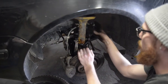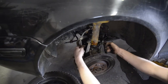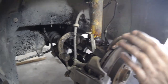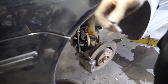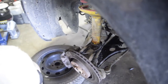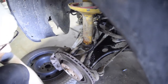First thing, again: ABS wires and brake sensors — mine's complete. Brake sensors that are still attached. Then basically just the one bolt for the knuckle here. The shock is going to slide straight out, and you've got one bolt up top for the top hat bearing assembly. The thing just slides right out. So this one's a 21, the lower is a 19.